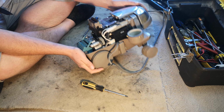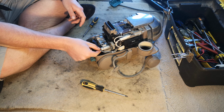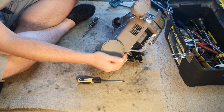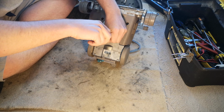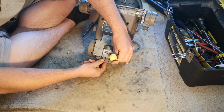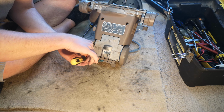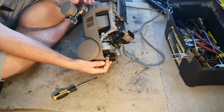So what we need to do now is take the switch off. This little bar here is for the switch, but we can forget about that for now. Then we cannot do anything with the belt until we've taken out the tech drive unit. We haven't got to take it fully out, just remove it. So undo this screw. Do not take out that screw, because that's for the cam lock. Again, I don't think it's the cam lock as well. I had a Kirby G5 with a chewed up cam lock, and it was a fairly different noise and experience.